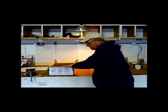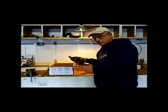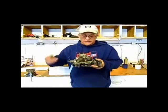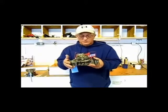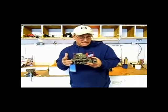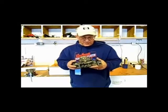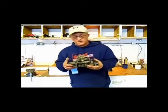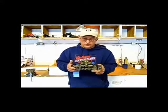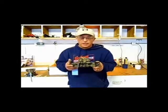That's the oldest style. Now, they may be 1 barrel, 2 barrel, 4 barrels. But then they moved up from that when they started coming in with computer controls, and they introduced what they call the throttle body injected systems. Now these are the injectors. This is off of a 305, 350 series of GM engines that came out starting in 1986 and then ran through 1995. And right now today, these engines that are equipped with these don't get the best mileage. They're generally somewhere between 8 and 12 miles to a gallon when I see them, but when I leave them, they're anywhere from 20 to 30 easily.